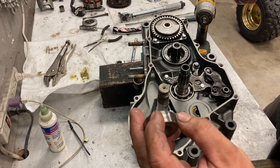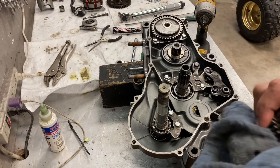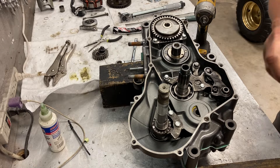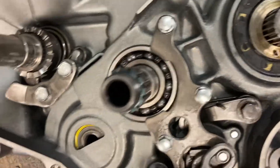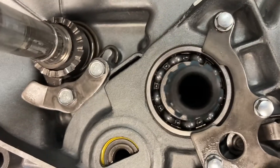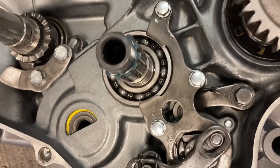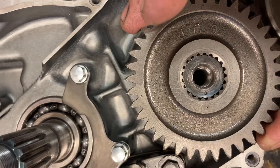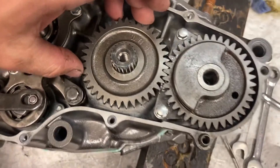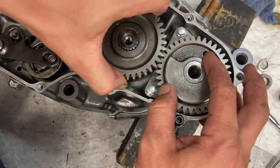This is your crankshaft sealing bushing that goes down in here. Now, this is important stuff so I'm going to grab my camera and zoom in for you. I have a series of dots here — make sure your surfaces are clean so you can see these very well. You have one on your actual shaft which is going to line up with this one. You're going to be dot to dot here. You need to line up your counterbalancer dots as well — you're also going to be dot to dot.